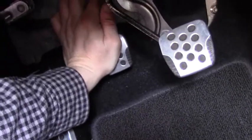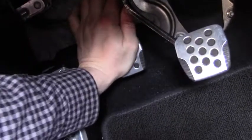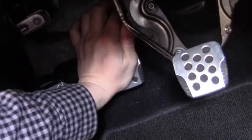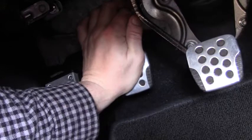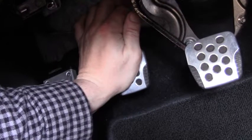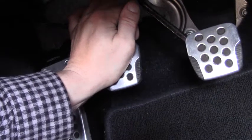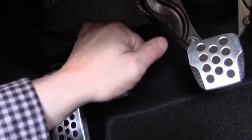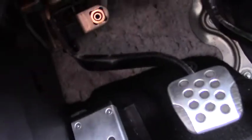It's on the floor, so I come out probably somewhere between 2 and 3 inches before it's making any noise with the throwout bearing. Okay, so that's definitely room. And then at this point, there's no grip going on with the clutch. The car is not going forward really. And I continue to come out and come out, and about right here it starts to grip, and then just right before I get to the top it fully grips, and then I've got this extra play. So you let me know what you think. I know that's not scientific.